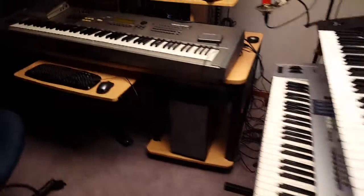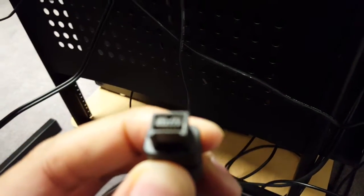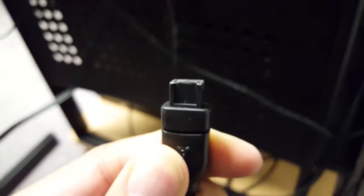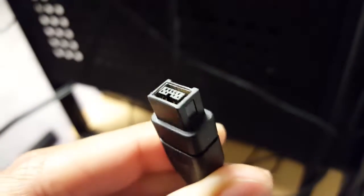I have a FireWire 800 interface and I've been having problems recently with my connection dropping out. The issue is this cheap IEEE 1394b connector on the 800 interface. This cable right here fits very loose inside my interface. Unless you do a custom cable with a metal connector, it's kind of wobbly inside that adapter.